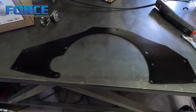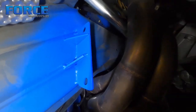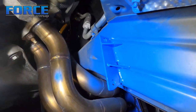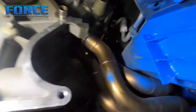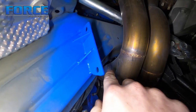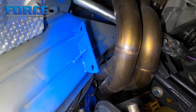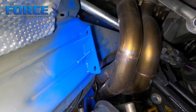I've got the chassis side done as well. Here are the supports in there — one side, and the other side. You can see I got a little paint on the header. Normally these braces would have one here so the block plate would rest on it when you put the engine in — just a stopping point. But since I removed this engine from the bottom I can't really do that, so I used them for supports in that direction instead, which will do the trick.